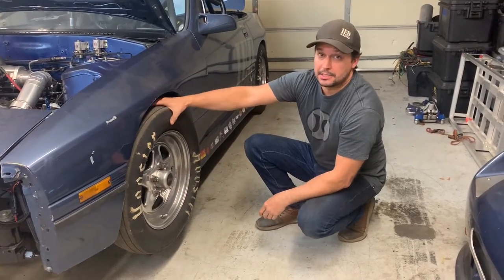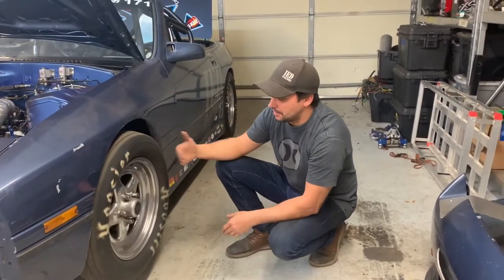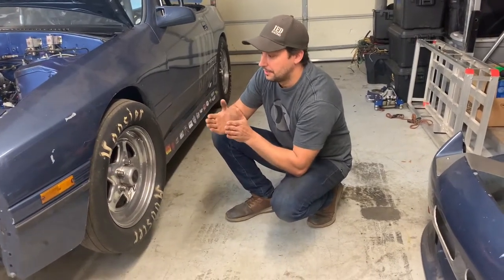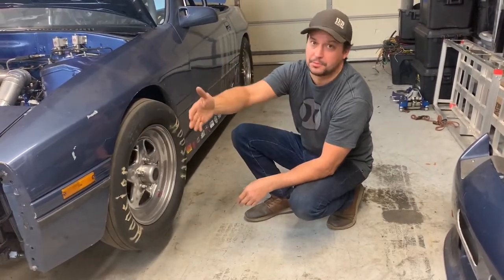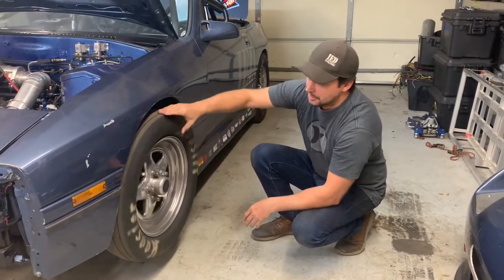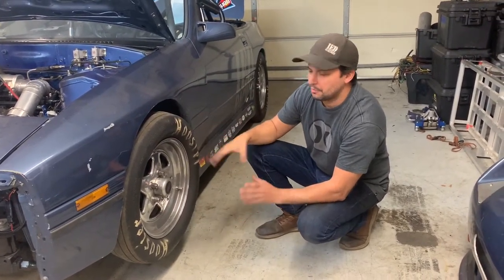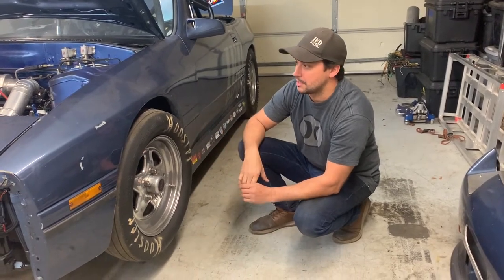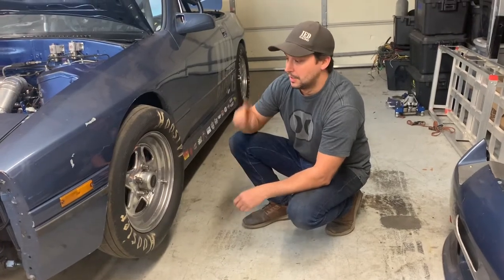So we have my stock wheel assembly on here right now. I'm just going to show you guys a quick little test as to why I'm going to switch this out. If I spin this wheel, you can hear that it's caught somewhat of a drag on there — the caliper and the pads are just riding on that rotor just a little bit. That roll resistance ends up as ET time when you're doing a quarter mile. So we're trying to alleviate that and make it a nice, easy, free spin. We're going to take this wheel off and disassemble everything, and I'll run a time lapse through the disassembly.